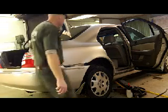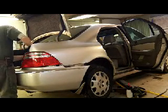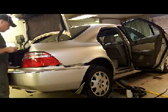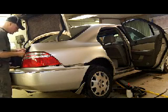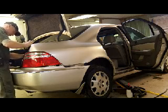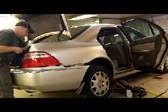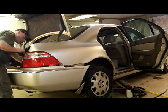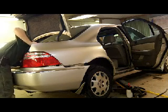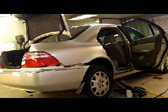Which reminds me, I need to turn the clip tool. This has push rivets that hold the carpeting in around. Actually, say you push in on those. Let's see. Survey says you win. I do a lot of these, but I've done a couple. Oh yeah, there we go. Okay, 8mm, we'll take that out, and the 8mm plugs that are in the back of these taillights.